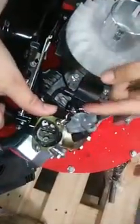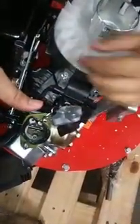Now that you're here, this is the fuel line right here — this is the main fuel line. The switch is already attached there. What you're going to want to do is unplug it here so it's loose to get to. You can do this by hand, but if it's too hard, get a needle nose pliers and pinch this together. Once you fully pinch it, it'll come right off.